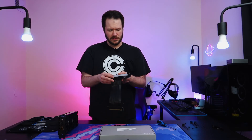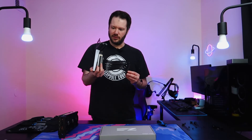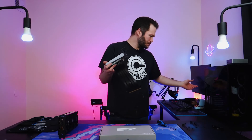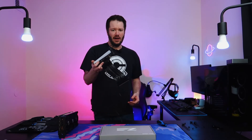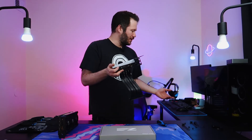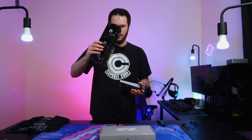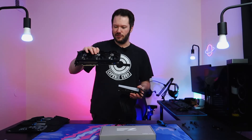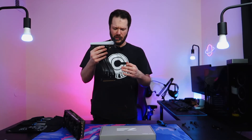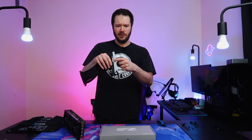This riser is only rated for Gen 3, so we'll have to change that out today. We'll also be doing some thermal tests to see if the card performs well in vertical orientation, which it should — that's the main reason I like these vertical brackets, since they pull the card away from the glass. The biggest hindrance with cases like this P120 Crystal is that it does have a vertical mounted slot built into the case, but it's so close to the glass it tends to choke off airflow. If you still have a triple fan card like this, it needs to pull air in, and if it gets too close to the tempered glass it can't do that well. This bracket actually sets it back in the case a bit further, and it does have a standard three-pin ARGB header for the RGB lighting.